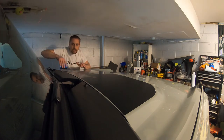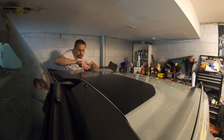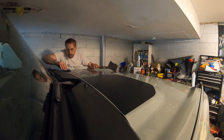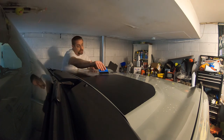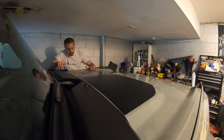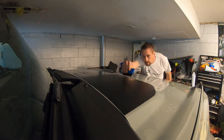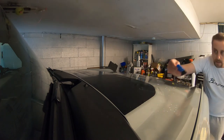Nice, it's looking very good. We got all the air bubbles out. Didn't mention before, but you want to make sure that the area where you're installing is all nice and clean — give it a car wash, get her cleaned up. Don't want to have any wax on there because that'll keep the adhesive from sticking. All right, I think we're good over there. Let's come back around — got a few wrinkles there, come back this way and get all that out.